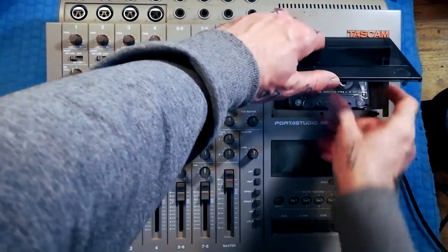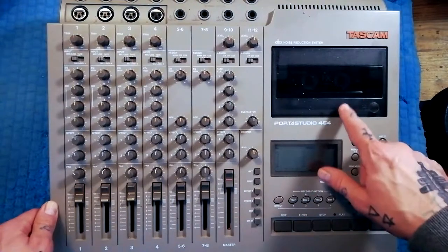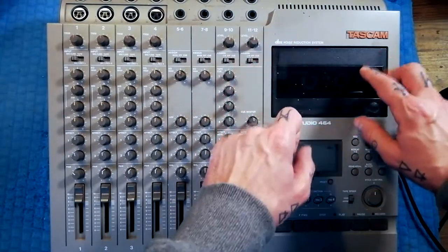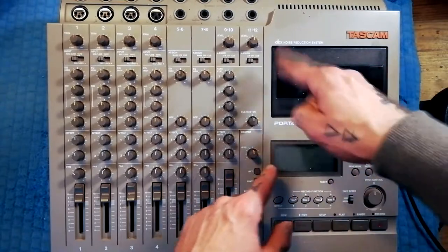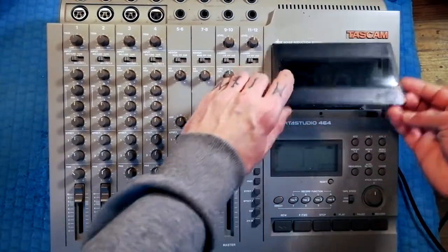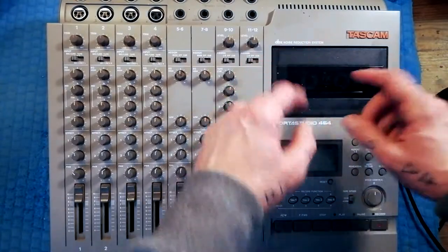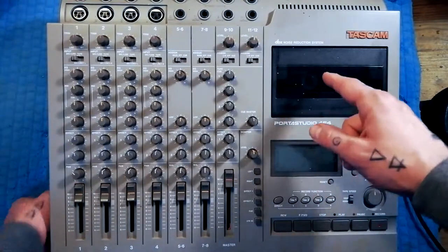Let's see whether we get any playback or recording. Right, so it's not playing. One of the things that often goes wrong with these — this is like one generation after the 244 and the 246 — the transport is still running off three motors. There's one turning a flywheel that turns the capstan, a separate one that controls the mechanism that turns the reels, and a third motor that changes what mode you're in, effectively raising and lowering the magnetic heads. It's somewhat more miniaturized, and instead of a rubber band between the control motor and the cams, there's a series of cogs and gears.